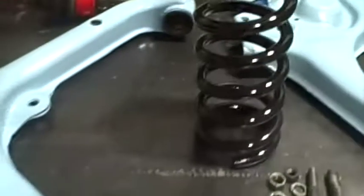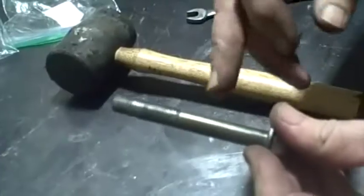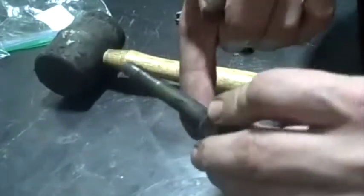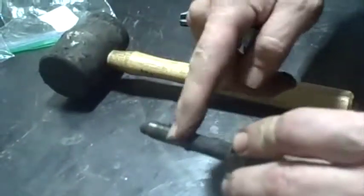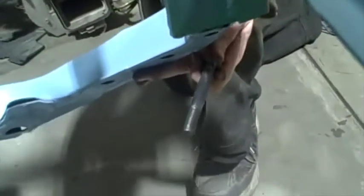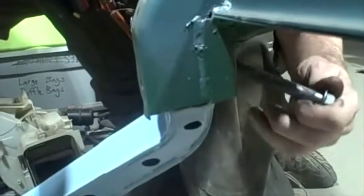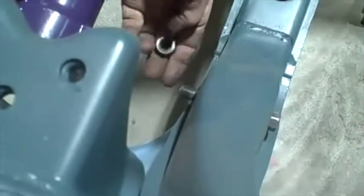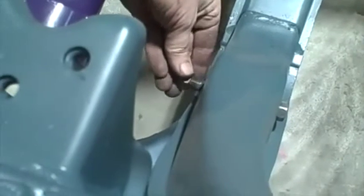Next I'm going to put in the front suspension arms. These long bolts - I'm just going to put a little bit of grease on these to help keep them from getting corroded, because they fit inside a bushing. The suspension arm slides up here on this side; I want to put it through from the outside to the inside. That one's in - washer and nut on there.